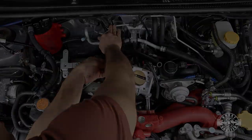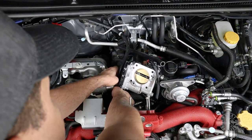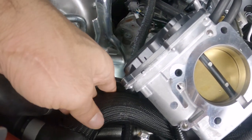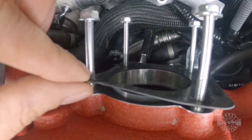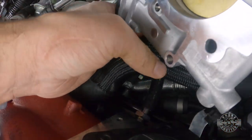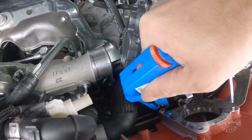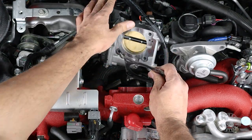If you pinched the lower coolant line, remove those hose pliers now. Here we have the PCV line installed earlier — it will ultimately rest on top of the AC line under the intercooler, going between the AC lines and onto the barb on the intake manifold that we exposed earlier. Push it all the way in, being careful with the reused gasket. Get your hand in there as best as you can and push the hose all the way flush. Secure it with an included zip tie.